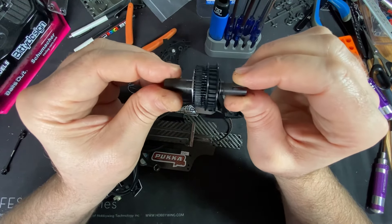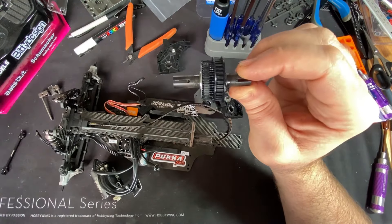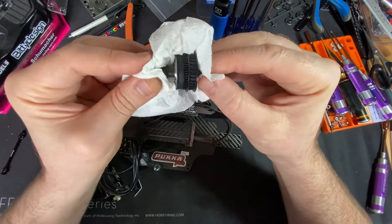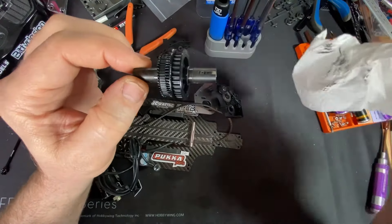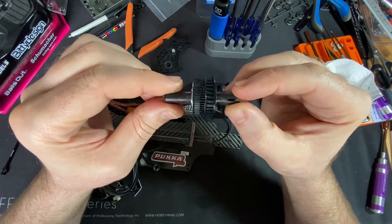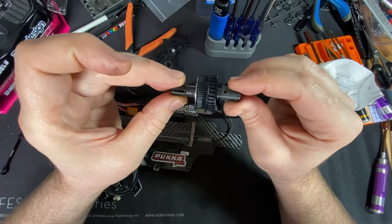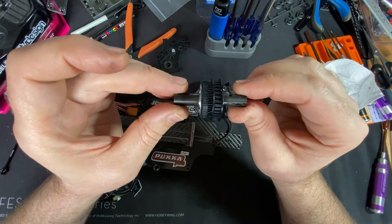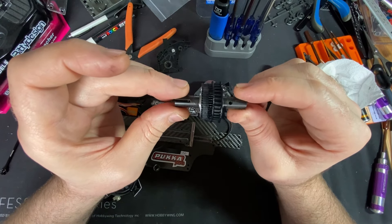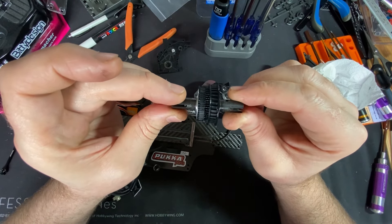I'll be getting a gear diff in it because other than that the car is absolutely great to drive — absolutely love it. We're potentially racing next weekend but the weather's not looking too good — one of the joys of living up in the Lake District. Last time a lot of people commented saying I didn't have any grease on it. I used the Speedworks non-fling grease, but this time I've used the FET grease that comes with it. The slipper was set with a little bit of slip, but you can't have too much slip because otherwise you're not going to get any drive or be able to brake.